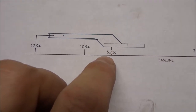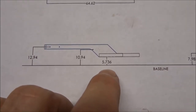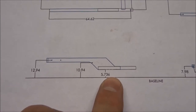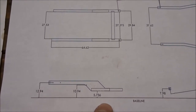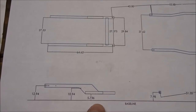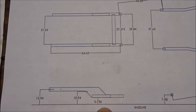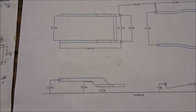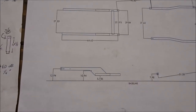Before welding, I got underneath and set the front to 5.736 inches, and just beyond the back half also to 5.736 inches — that leveled the floor support to the baseline. They are sitting much better than when I first installed them. Taking the time to do all this measuring and using technology really helps. I might be a little overboard, but this is where the foundation of the car starts and I want it to be perfect. Using SolidWorks really helped get things where they needed to be.